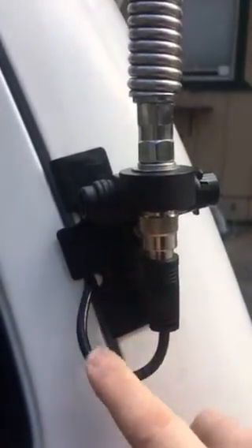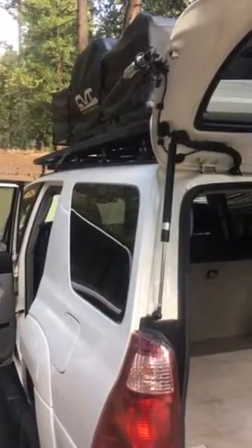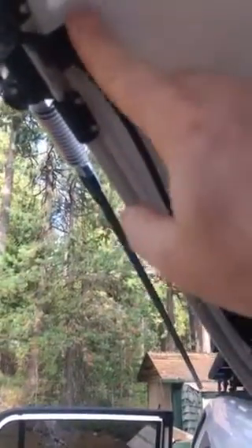The cable naturally dips in behind the Diamond mount. Now, a pro tip: be really cognizant of where you put your antenna on this application, because if you have an awning like I do on this side, it will interfere and hit it as it tries to open. I bought these little clips — half open on one side with 3M tape on the back — and the coax cable goes right through them.